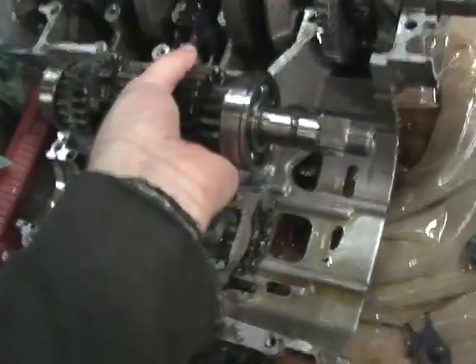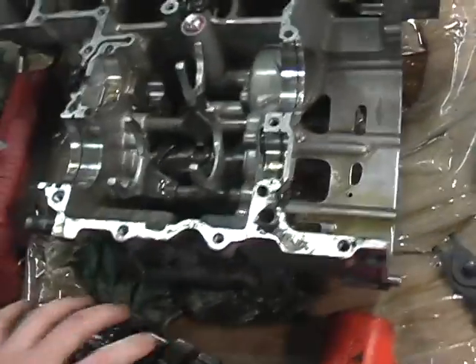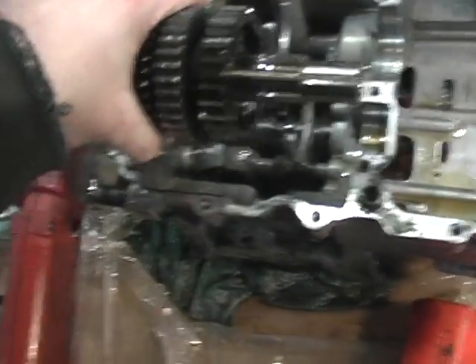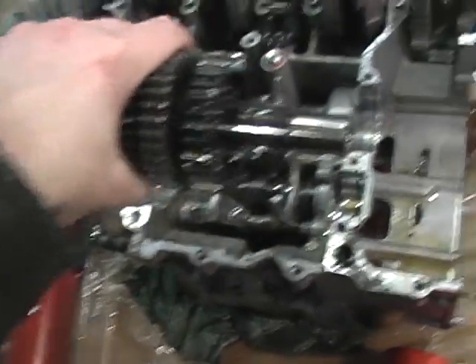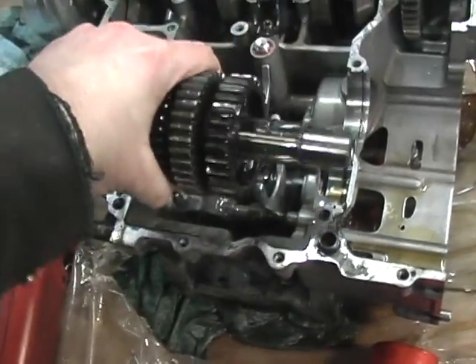This one sits here and this is where the clutch basket would link up with this one. It's all the pinions. This other shaft goes this way and this is where the actual gears that you'd be replacing are. They just lift out — they're a little stuck.